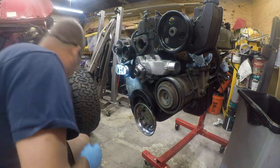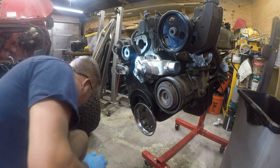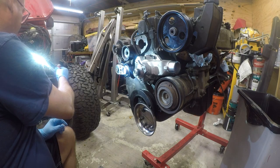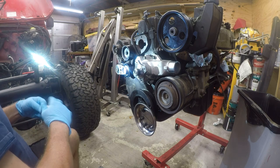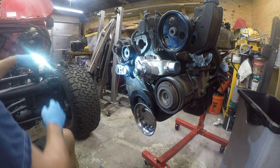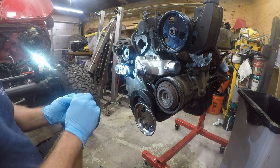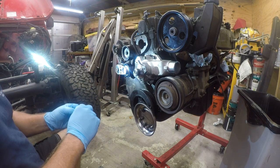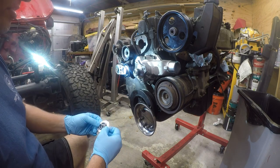The RTV, so I'm going to put the cap back on. And we'll put some thread lock on this. I just don't trust these. These are really low torque value bolts. Okay. I'd feel better if this had a bleed valve, but it doesn't, and it'll eventually come out. Very tempted to drill one.